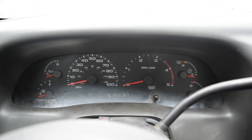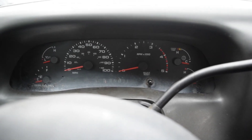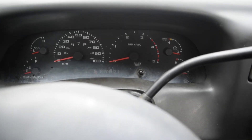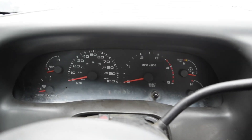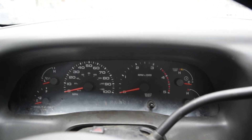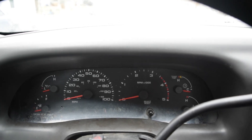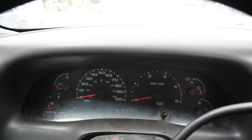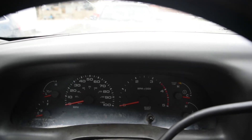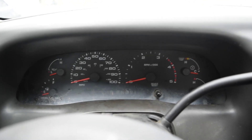Which brings us to this truck — a 2003 that is my dedicated plow truck. The only time I drive it is in the wintertime when I'm plowing snow. The other day while plowing my driveway the truck basically just died on me. I didn't have the headlights on so I didn't notice them getting dim, didn't notice that the plow was turning kind of slow, and all of a sudden the truck started running real rough. When I went to raise the plow and hit the button, the truck died.